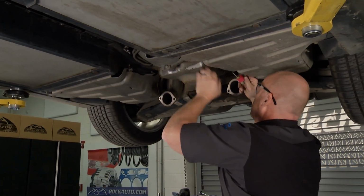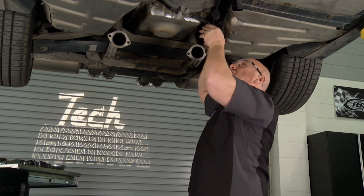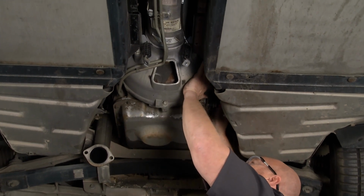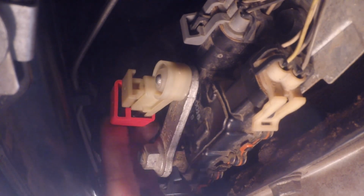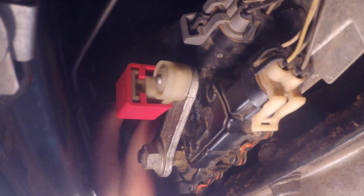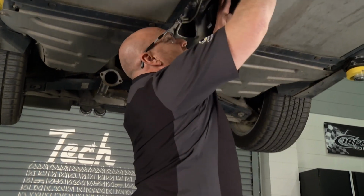Now, back here, you can see the new linkage, and you can see the safety connector here, which is going to help hold that ball right in place. So once again, bracket upright, headed north, get the bushing in here to hold it, slide my shift linkage back. Remember, John left this thing in neutral, so we're going to be darn close when we seat it. And there it is. Now, slide my safety tab back, pull my lock hasp up, red tab back in, lock it down, and we're set. Now, one more adjustment right up here to this bracket.